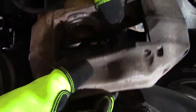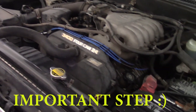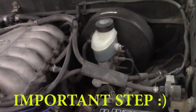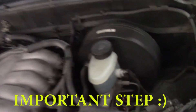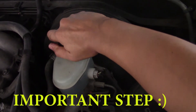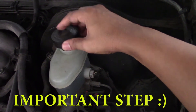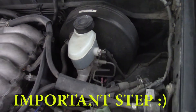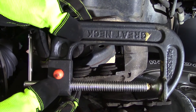With the middle retaining clip removed, it's all out. A very important next step: go to your brake master cylinder and pop the top. This allows airflow and reduces pressure when you're depressing the caliper pistons. If you don't pop this top, you could break a valve within your master cylinder — that's extra work you don't want. So remember to pop the top a little bit. You don't have to remove it fully — just don't let any foreign material fall inside. Just pop it a little bit to allow pressure to be reduced.